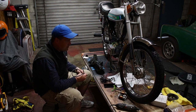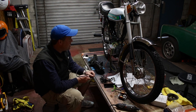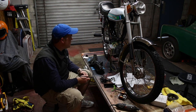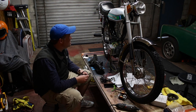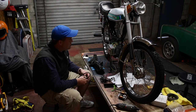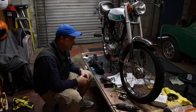just being careful and double checking and grinding the paint off of the grounds. I like to have grounds right on bare metal, so I'm gonna make sure I do that. And I'm gonna have multiple grounds. I like redundant grounds. I'm probably not gonna record it because it makes for a really boring video. I'll come back and show you how I did it.